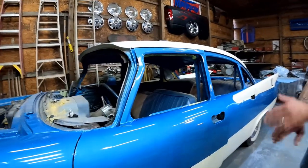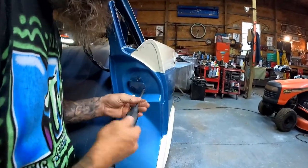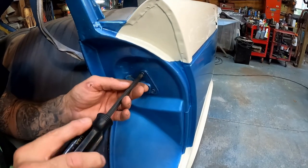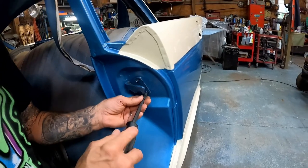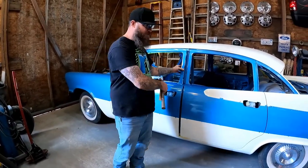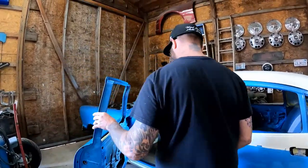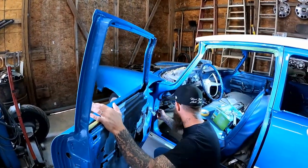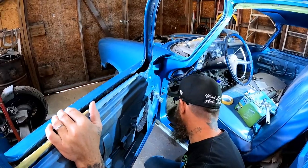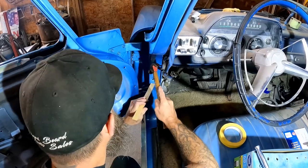Stand back and look — we've got all the panels on the side of the car finally, all the way around. All that's left is a hood. Be nice and easy with this stuff because it's all been painted — we painted the latches, the screws, the bolts, everything. Something was springing out right here and I was like, what on earth is going on? We already built this thing before during the bodywork stage and made sure everything would go back together just right. I noticed the door catch is just barely sticking up and it's actually rubbing the face of the door, so we'll have to tap that down.